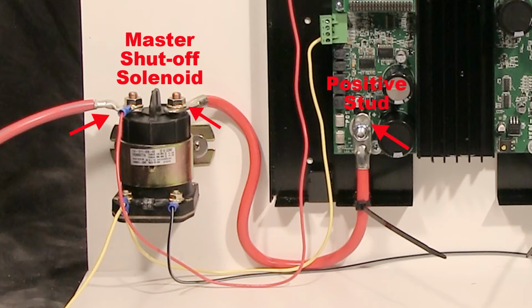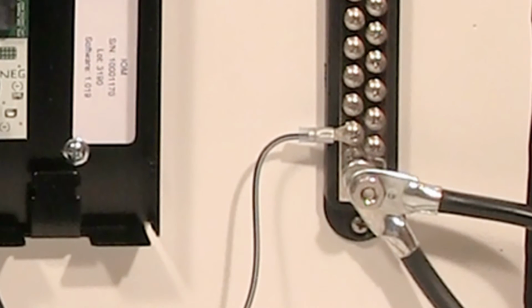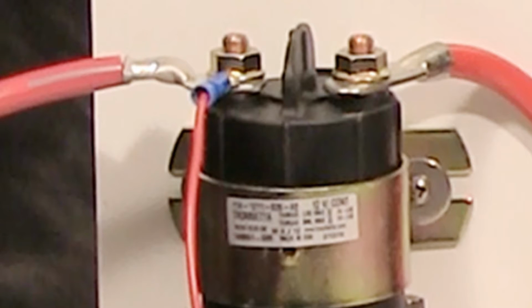Connect a wire from the ignition 12-volt to one side of the solenoid. Also run an additional wire from this point to pin 4, plug J16 on the IOM. The wire size should be at least 18 gauge. Connect a ground wire from the other side of the solenoid to the chassis ground or connect to the optional grounding block. The wire size should be at least 18 gauge.